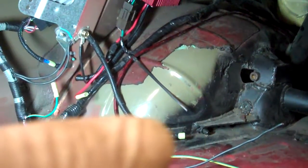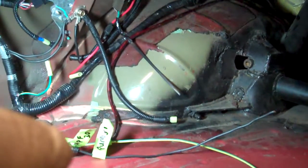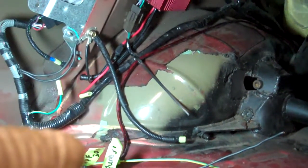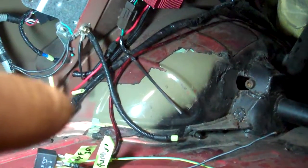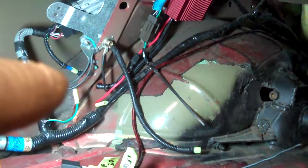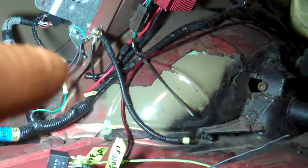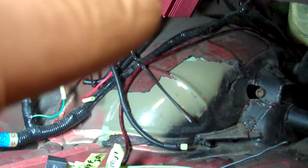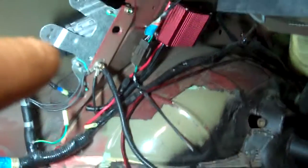Over here you'll see this wire — that's going to be a ground wire for the relay that we're going to install. This power wire down here is going to the relay; I was doing some mock up and I just left it, I didn't want to pull it back off. Over here you're going to see a connector that runs from the booster pump — that's going to be the power going into the booster pump with the 30 amp fuse on it. Back here you're going to see where the CCRM wire was cut in half, and now the amplified voltage from the booster pump is going to where the CCRM wire was going into the FPDM.